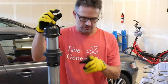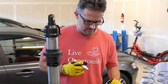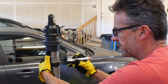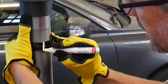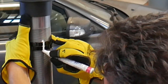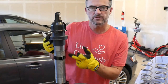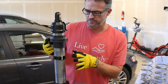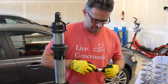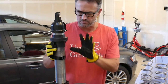Now I want to mark this so I can monitor it. I'm going to put a little mark across these rings and also on the shock body itself. This is the front of my shock absorbers. If I'm at the track making adjustments, I want to be able to visually look at this and make sure it hasn't moved. If the lines on the rings line up with the dabs on the body, I know it hasn't shifted and I know I'm good to go.